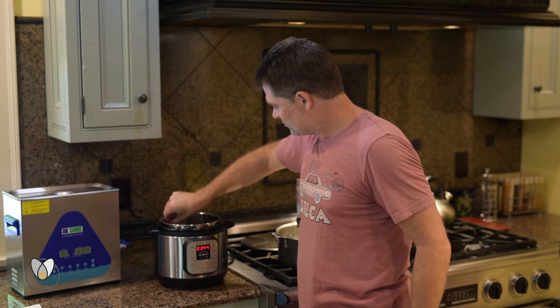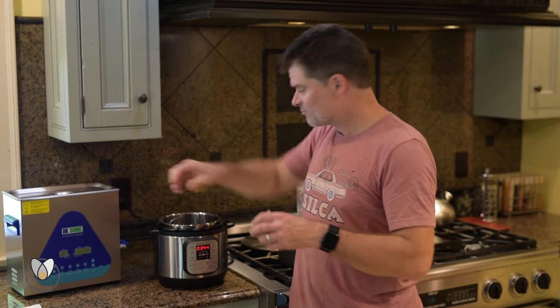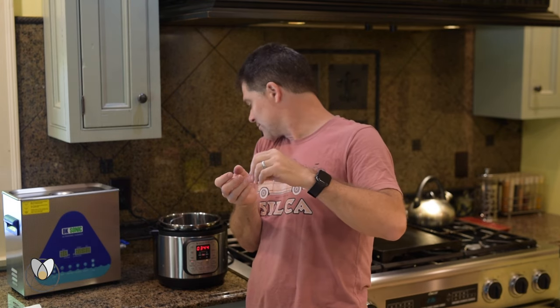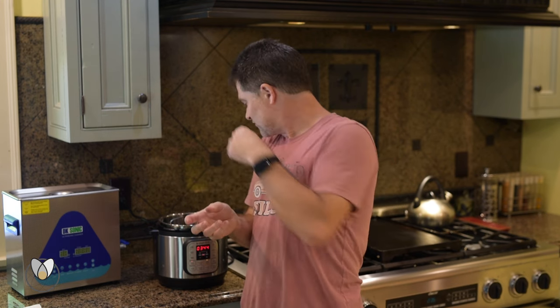Go all the way down — you can see we have our nice handle sticking out of the top. We're basically just going to get it in there and swish it around, really stir up the tungsten that's now going to want to sink to the bottom, and also try to get the air out. Here you can see the air actually coming out as it expands due to the heat.